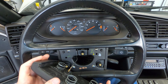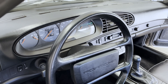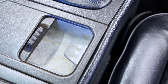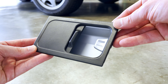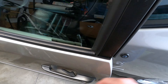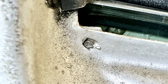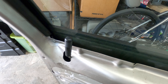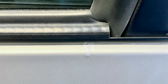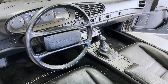For the interior of the car, I replaced the four-spoke steering wheel with a nicer-conditioned pre-owned one pulled from a 1986 944 Turbo. The original steering wheel was showing some signs of age, with a few cracks in the leather wrap and the stitching across the top edge completely deteriorated from sun exposure. I also reconditioned the inside of the metal ashtray on the center console that had developed some surface oxidation — with the ashtray assembly removed, the metal cup can be pulled from the side of the plastic trim piece, which provides easy access for sanding and coating. Finally, I took some steps to stop the spread of a small crack in the outer door panel at the base of the driver-side window seal. This is a common issue that can develop on the 944 due to a failed weld at the rear window guide inside the door — when the weld eventually fails from overuse and vibration, that pressure is passed onto the outer sheet metal, causing it to crack. So I clamped the guide rail back in place, popped on a quick weld, and covered it up with some touch-up paint. Interior restoration costs for year five came to a total of $150.